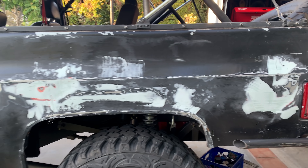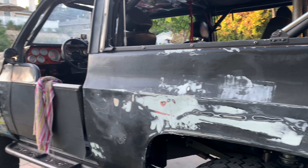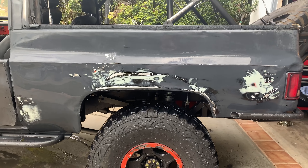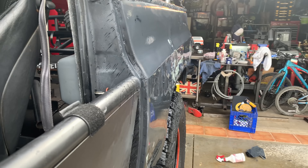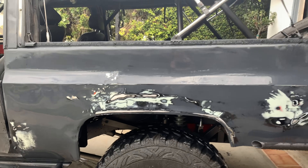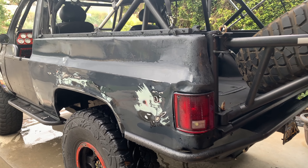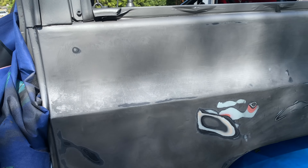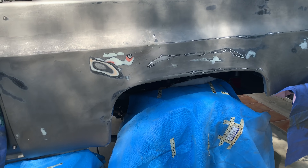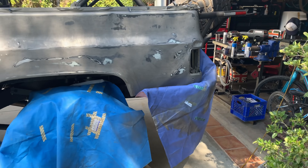If it's not obvious by now, I am not a body guy. My objective here is to get it presentable, not perfect. I want to preserve these panels because they are original, so I'm not too concerned about waves in there. I did want to remove as much of the imperfections as I could, so this is about three coats of primer, some Bondo, and a lot of wet sanding. And I'm happy with how this looks — it's got all the high spots out of it. It's not going to be perfect, but it's actually a pretty sweet patina.